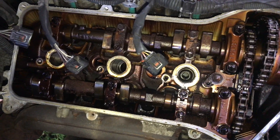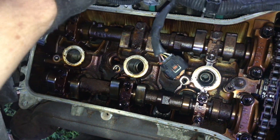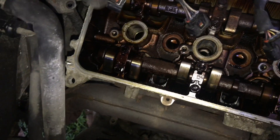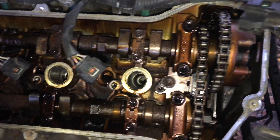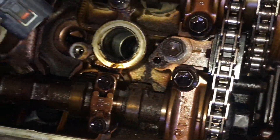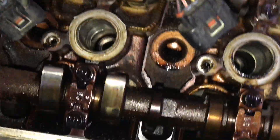I'm just digging down looking for the problem. From here you can see where all the lobes are, and therefore where all the valves are. You can't really tell if the valves are bent, but you can look in the spark plug holes and see how deep the cylinders are, and check the firing order with the position of the lobes — checking if each cylinder is in the exhaust, compression, or intake cycle. I can see down to the piston heads.